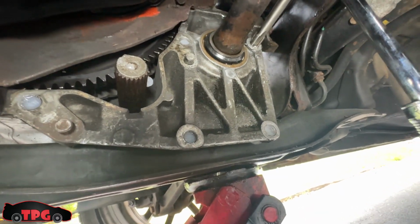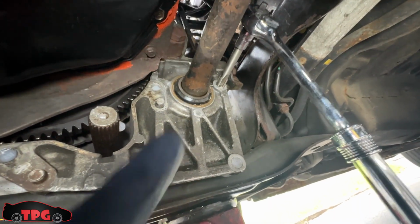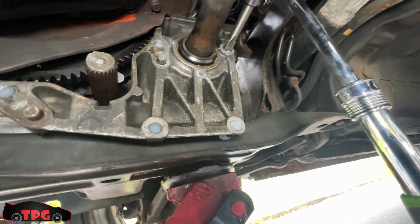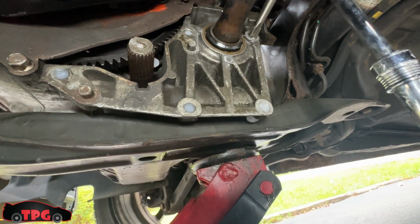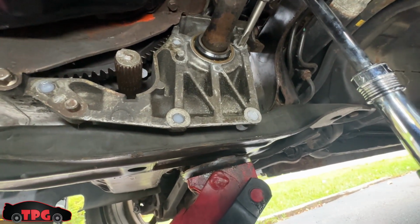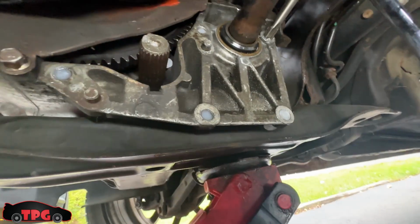ones with the right size 12x1.25 tap, not the one included in the kit because this one's bigger, so you can install the helicoil, but I have more taps, so I'm gonna tap these other 2 holes here just to hopefully clean up the threads. But helicoil will make it stronger than it is. I mean, they're dissimilar metals, so putting a steel bolt, a hardened steel bolt, you know, grade 8 or whatever bolt into an aluminum case, you always run the risk of dissimilar metals getting together and making bad stuff happen, making it hard to take them out.